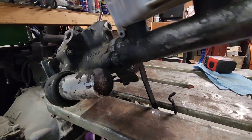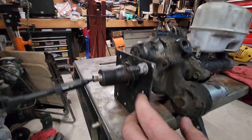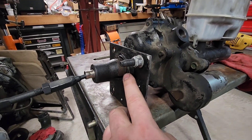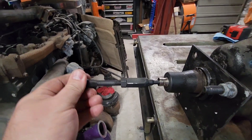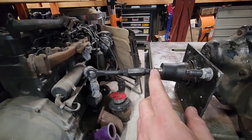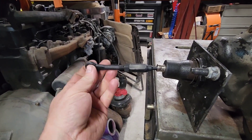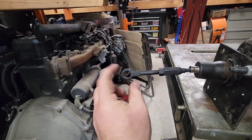Here's the new bracket on the '04 hydro boost. I put the other mounting plate off the '98, put the nut on, and snapped the snap ring back on. Here's the piece welded on. I just tried to zap it in — basically spot weld it — and immediately cool it. It's the correct length with this threaded piece from the original Tahoe booster.